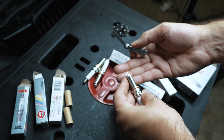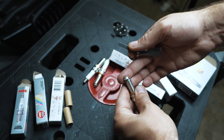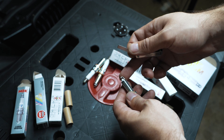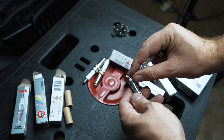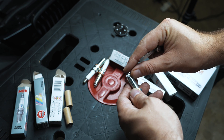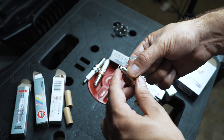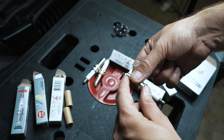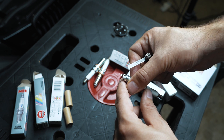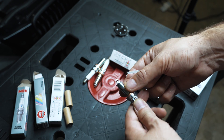The trade-off when you do this is you may not have as nice cold starts. It should be fine when warmed up because there's less spark gap, so when the car is cold there's less likelihood that the fuel will ignite. I'm in a pretty warm climate so it shouldn't be a big issue. Some people go as low as 0.018, and it's recommended — unless you're at crazy high horsepower — to go to 0.020. I'm splitting the difference at 0.019, which should work for my climate.